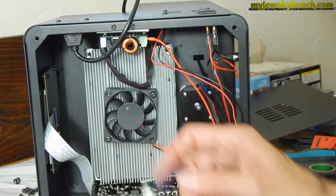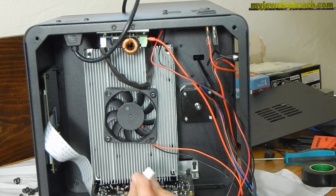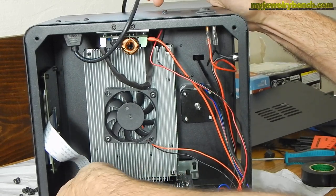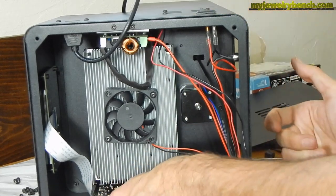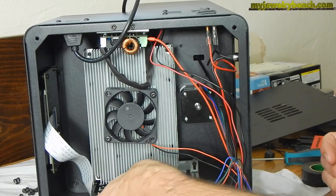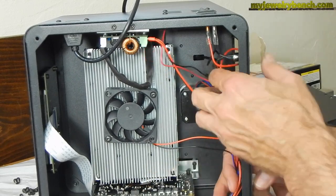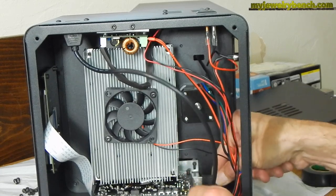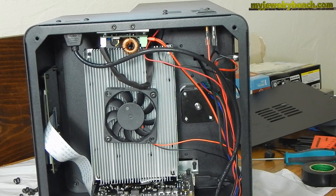We have two more connectors. The smaller one is for the light sensor for our stop switch — that goes right here. Then we have the adapter for the stepper motor — the Z-axis motor goes right in the middle, and it should go in relatively easily. All our cables are plugged in. Don't forget to plug in your USB cable. Now we can go ahead and turn this on and do an array test to make sure the array is actually working correctly, before we button this all up.